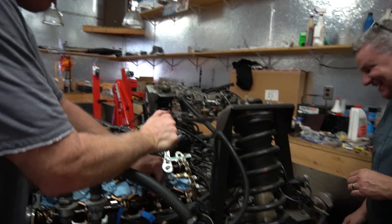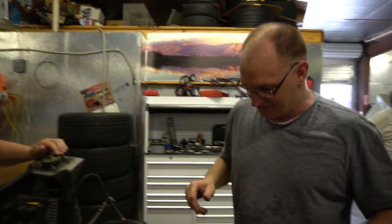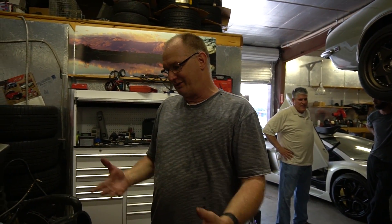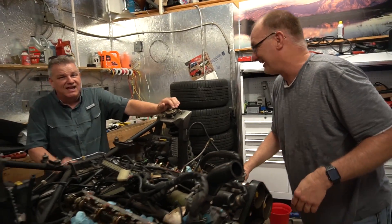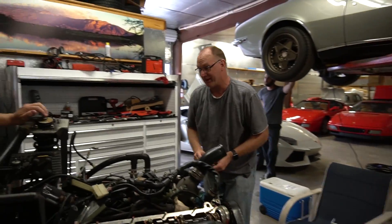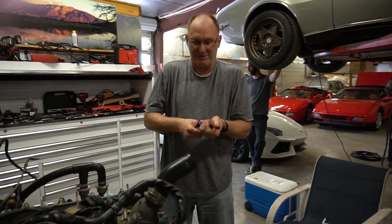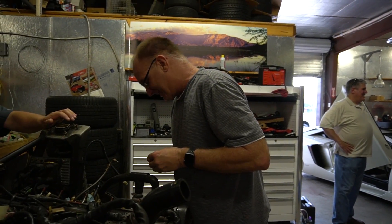Are you going to have enough cardboard or do we need to get you some more? We just need to do one cam on each side, right? No, you have to do all four. So it takes four business card pieces to hold that cam. Usually I use one of my old business cards where it says Master Technician on it — they actually made good paper. Sometimes what I'll do is loosen it, collapse it, and then tighten it.